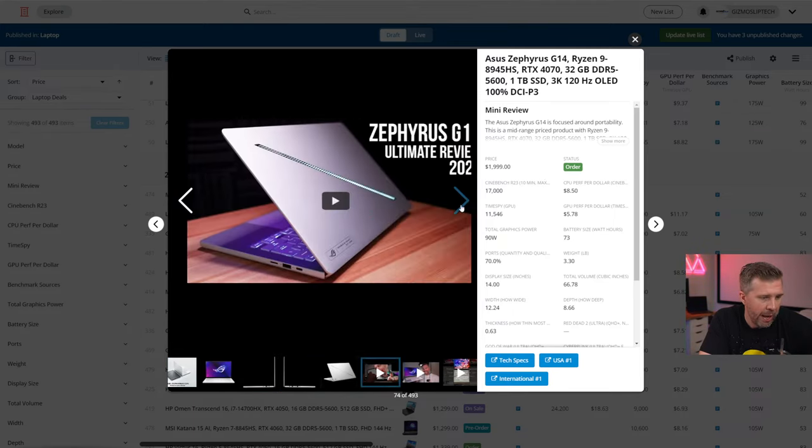Theoretically, additional cores and threads will help multi-core rendering more. So you can see in our initial first run, 17,000 versus 17,700. Let's try a second run. See how we do. All right, so peak boost clock, 4.8 gigahertz on the primary cores for the Ryzen. For the Intel Ultra 9, our boost clock for the P cores is only about 4.1 on the fastest, and then the slower P cores are at 3.9. So basically we have a linear down-ramping with the Omen 14 cores, with certain cores being higher priority cores at slightly higher clock speeds.